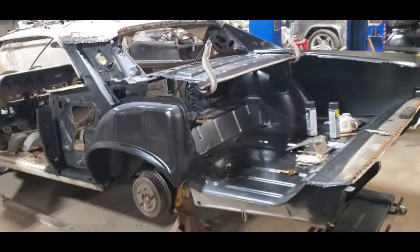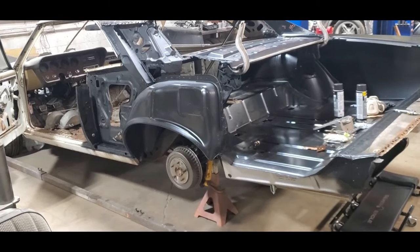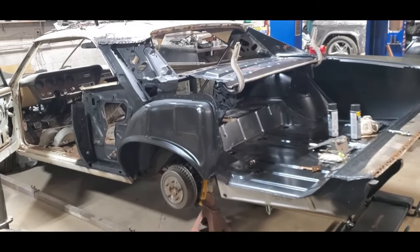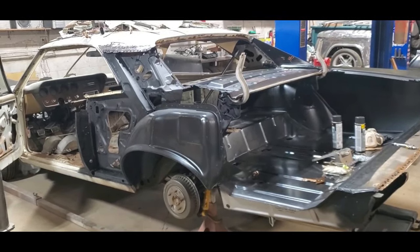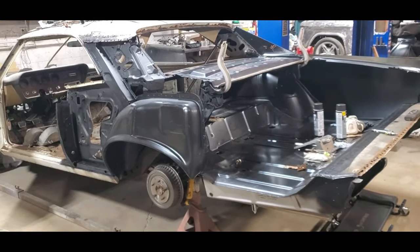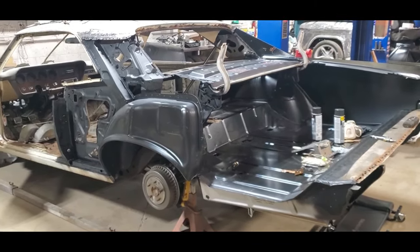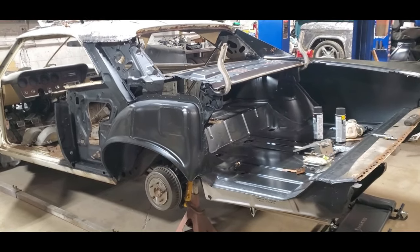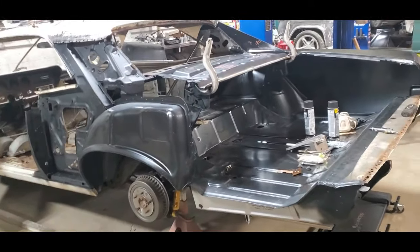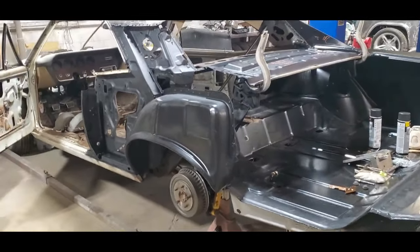You want these things to sit on the car in a relaxed state. When you start welding, things start moving. If you've got something stressed before you start welding, it's going to be stressed even more after you finish. I've seen cars where a guy might lean up against the quarter panel and the whole quarter panel caves in — because the metal is under so much stress that it just takes a light touch and it bends inward. You can pop it back out, but it's not a good thing to have stress in a panel.